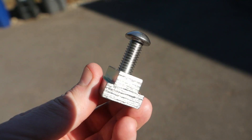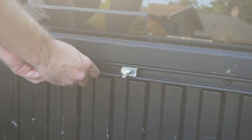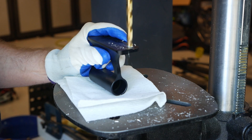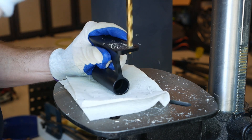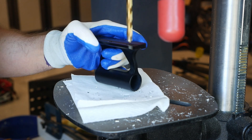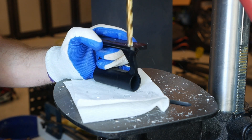I'm going to be using these track adapters for my Toyota bed rails — will it work? I'm not sure, but let's find out together. Because the track mounts use a 3/8th bolt and the Muxi's factory holes are just a bit shy, I need to drill them out. No worries though, as they're made of aluminum and thus drill very easily.